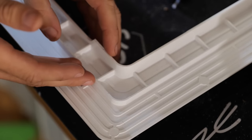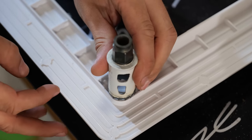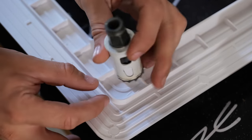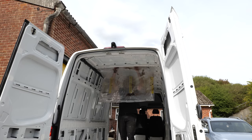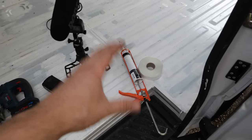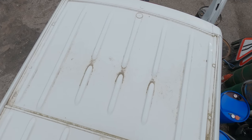Having watched videos about these fans where people get leaks, the majority come from the corners. Instead of cutting a 90-degree corner, I'm using a hole saw to match the external radius — it looks to be about 25mm radius, and I have a 27mm bit which will get me pretty close, then I'll file into the corner to finish. I want the metal as snug as possible against that corner because that's the point of failure for a lot of people. I've got everything I need — layout tools, cutting tools, and sealant. It's taken me about an hour to get just these together.